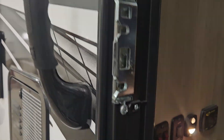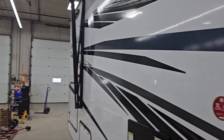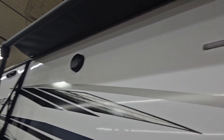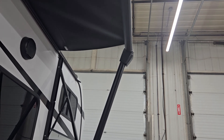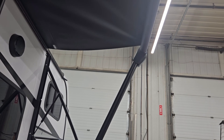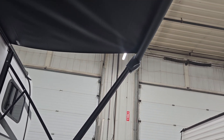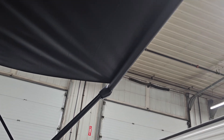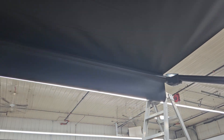Right next to that you have your awning extend and retract switch. Hit that awning extend button and the awning will start making its way out — always making sure you're not going to come into contact with anything. You'll know the awning is fully extended when you see the little flap hang down in the back of the metal tube. Sometimes those flaps get stuck, so you'll just have to retract it quickly and extend it again.